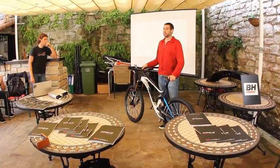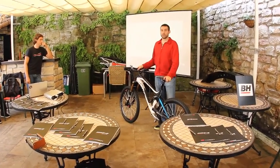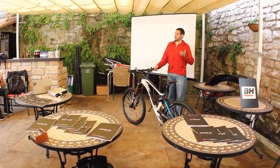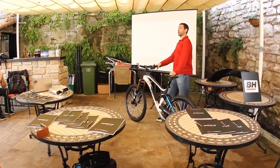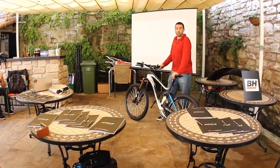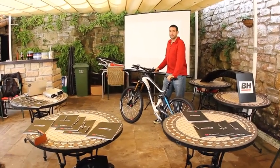You want to balance the two, then you've got to give up something. With this, we don't have to balance it. We can take the best single pivot location that we can come up with. I want the bike to feel the same under braking when you're at half travel, at third travel, at 70% travel. I truthfully don't care what it feels like at the end of the travel, but it's simply to keep it constant. But if you're really worried about what your bike is feeling like braking at 100% travel, I imagine you're about to crash or something.